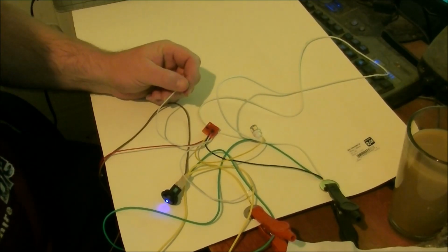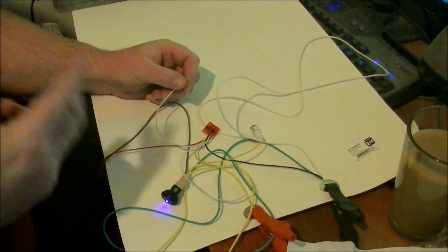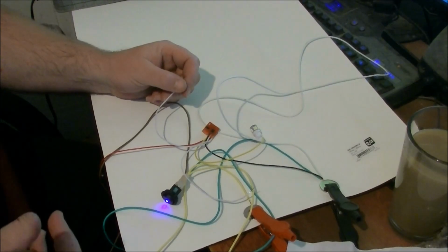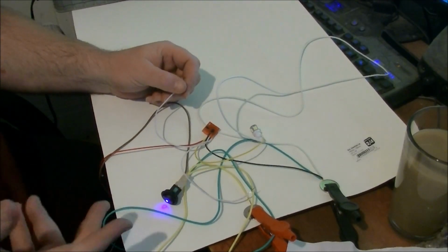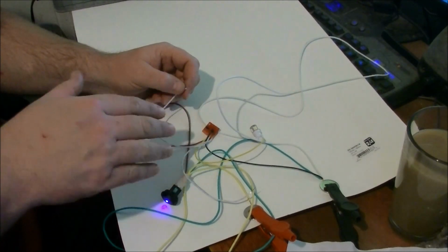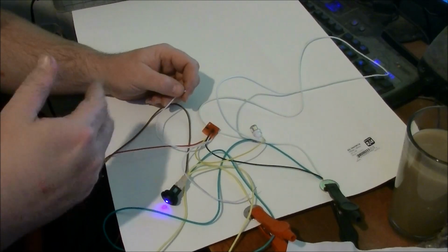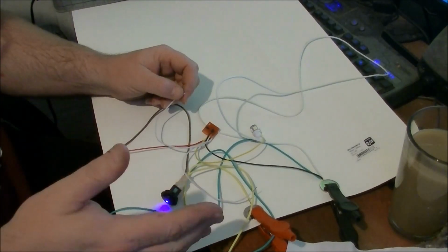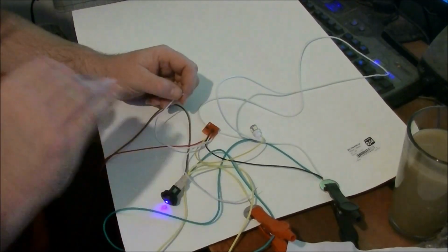What that means is that there's not going to be any cycle between, so every time you step on the brakes, even if you're in traffic and you're stepping on the brakes, stepping off the brakes, stepping on the brakes, it's going to flash every time. Some people like that, some people don't, because it can be a pain in the ass, I guess, if you're behind that person with the flashing brake light, and every time you're stepping on the brakes, the thing is flashing. For me, not for this demonstration, but for later, I would put it maybe on a 10 second timeout, so that when you take your foot off the brake, there has to be a 10 second delay before the light will flash again. So if you're off it for 5 seconds and you step on the brake again, it's not going to flash, it's going to come on steady.